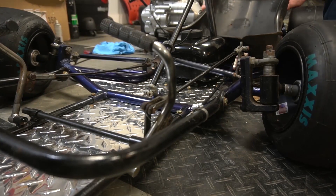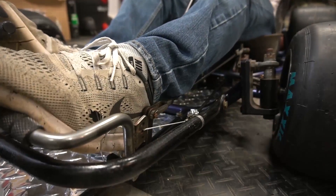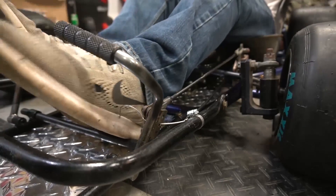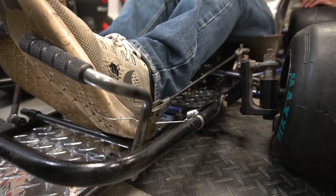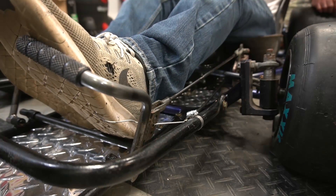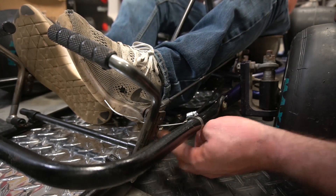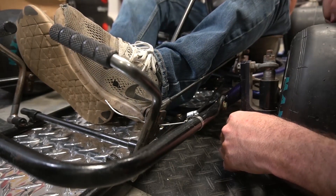All right, I'm going to do a test of the clutch — if you press in on the clutch... it didn't do it. It slipped. Yeah, it slipped — the barrel. Look at that extreme angle it's at; it's not pulling just forward but sideways. You're losing half your pedal power doing that. I would weld something between here with a hole in it for the cable to pass through. Anyway, we need some more barrel nuts so we're going to order those as well.